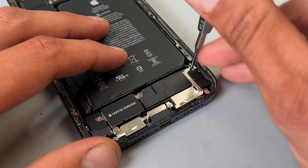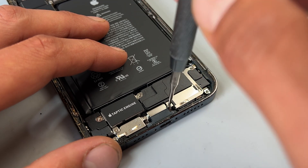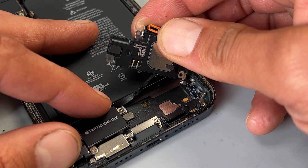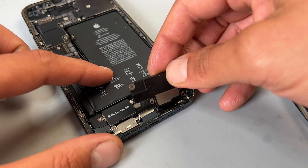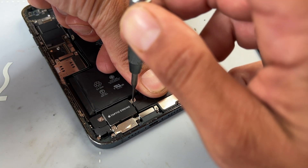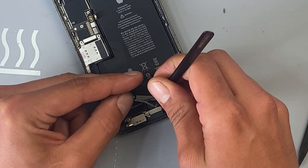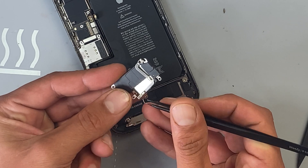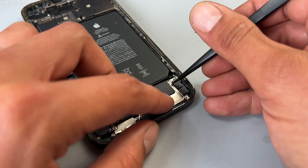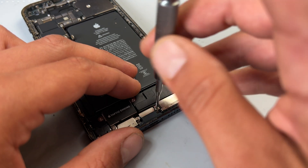Now that we're inside the phone, removing the loudspeaker itself is quite easy — just unscrew the four cross head screws from each corner of the loudspeaker, then use tweezers to lift the loudspeaker from the chassis of the phone. There is a little bit at the back where it's stuck with some tape, just peel that away. Taking the new loudspeaker, just pop it into place and secure it down with one screw. Comparing the two, there is a metal bracket that needs to be transferred over — it's stuck to the loudspeaker but not particularly strong, so we can release it with tweezers and place it onto the new loudspeaker. Now reinstall the other three cross head screws and that should be just about installed.